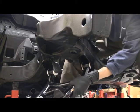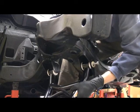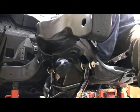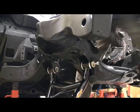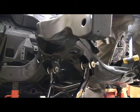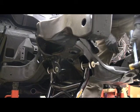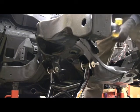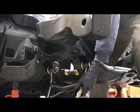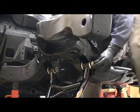One thing to note - not in the Global West instructions but in the assembly manual - is that these bolts have to go in with the head side to the front. Not sure why, but that's what it says. A little persuasion and they should go in. Then a washer and a crimp nut on the back side.